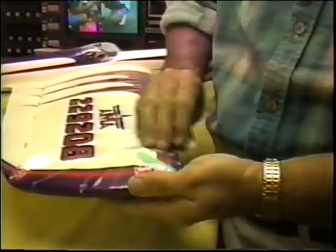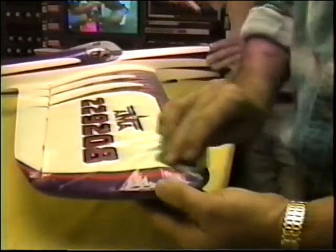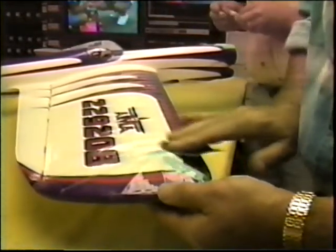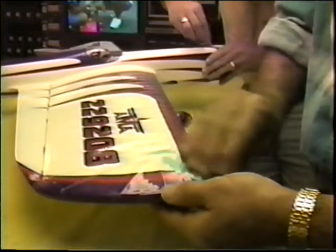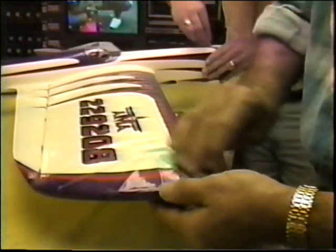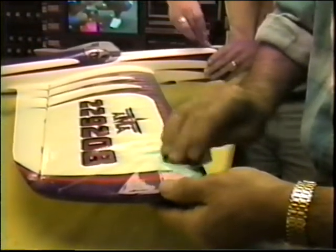Now, as long as you're going to wet sand this, it doesn't take long, and you can get the M600 out and some 600 paper and get a final blend on this. What you're really looking for here is to get the edge feathered, that at no point in time does it just end. It kind of feathers out. By the way, you can even see the rib coming through here. This sandpaper repair is really, I don't know if we've come up with a good idea here.